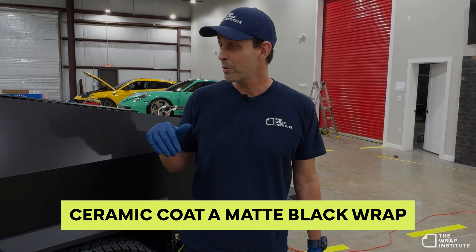We're going to be using a product from Diamond Pro Tech called Diamond Wrap for PPF and vinyl. There are two main reasons we like it at the Wrap Institute. First is the flash time — instead of most other brands at around 30 seconds, which can be super tricky on a matte finish, this one is between three and five minutes. That gives you a lot of time to get the coating on and a safe window to remove the excess film so you don't get high spots or low spots.